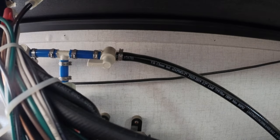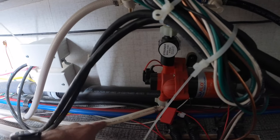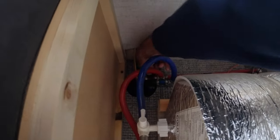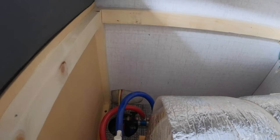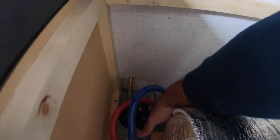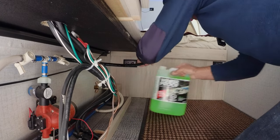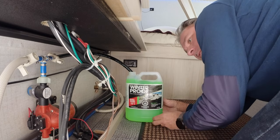The antifreeze is going to pass to the pump and get pumped through to your faucets, toilet, and outside shower. We will start by draining the closest points first, then close the low point drains again. Most trailers have low point drains — sometimes they're located on the outside with little cups. This unit has pull-and-push-in valves, which are much easier, but they're very flimsy and fragile, so be careful when pulling on them. Hold the whole plumbing so you don't break anything.